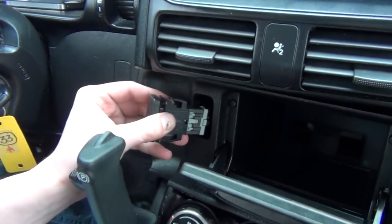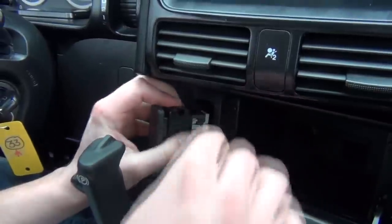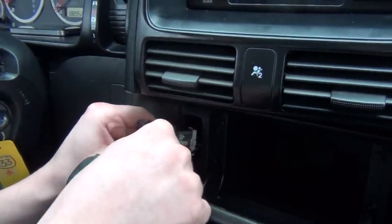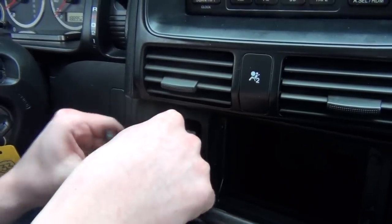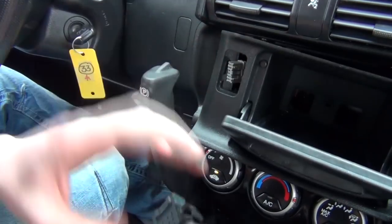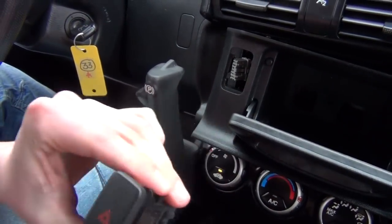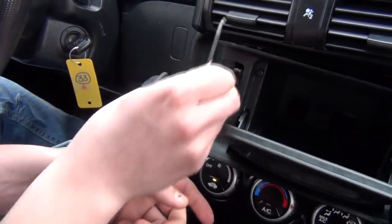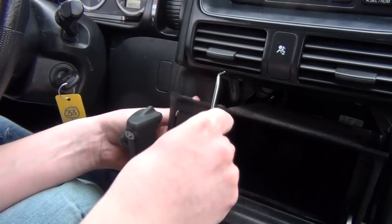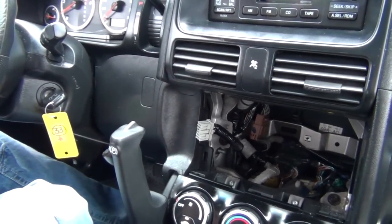There's this clip, and if you don't remove this hazard light it's really hard to get to it. We're going to use the hook again — press on it and it's going to come off. What I did is pressed the two tabs and then pushed it out. To put it back, you just push it back in.